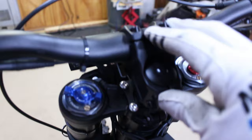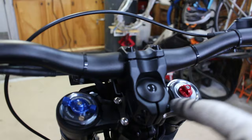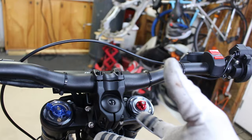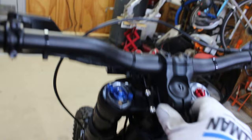Another thing you should check on these bikes is your headset. I've been reading about people's headsets getting loose, riding with them loose, and it rattling back and forth — pretty much boring out their steer tube, and once that happens it's kind of game over. If you have any play in your stem or steering, loosen the pinch bolts — one on each side — remove this rubber grommet, and there's an allen key bolt underneath. The more you tighten that allen, the more your stem bearings compress together. Have it up on a stand, tighten it, and make sure your bars are still able to move — don't over-tighten and damage your bearings. Then tighten back up the two pinch bolts on your stem.